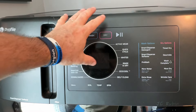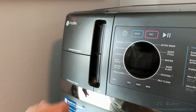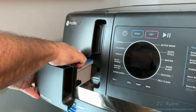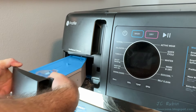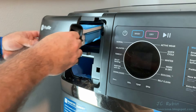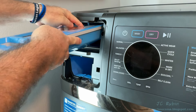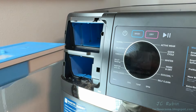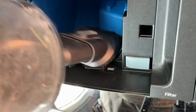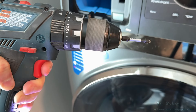This panel will be the first piece removed, working not to damage it in any way. I start with the removal of the fabric softener reservoir — push down on the tab and remove the entire unit, putting it to the side. I then remove the detergent reservoir, pushing down on that tab at the end to remove it. Both may be filled with liquid, so any opportunities to clean up dirt are taken.